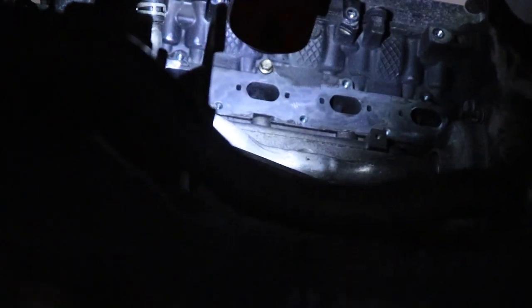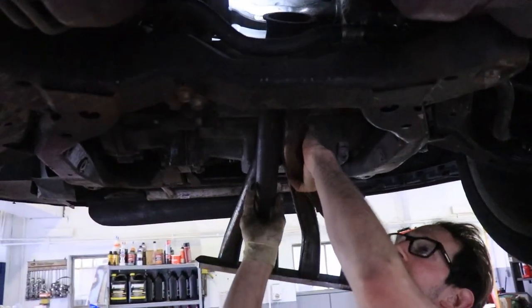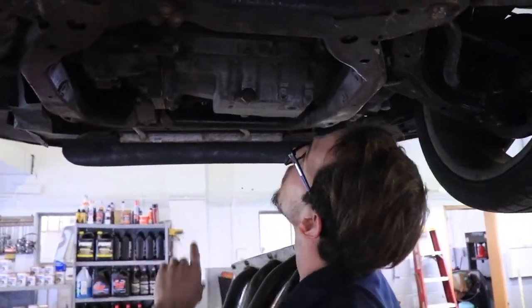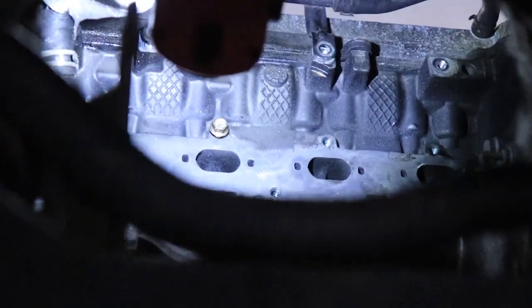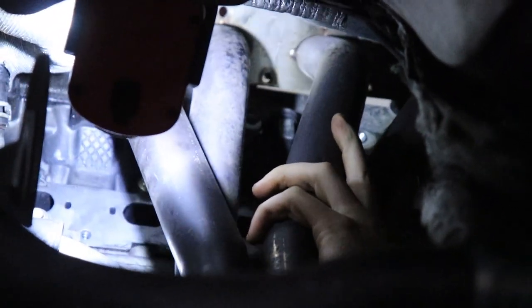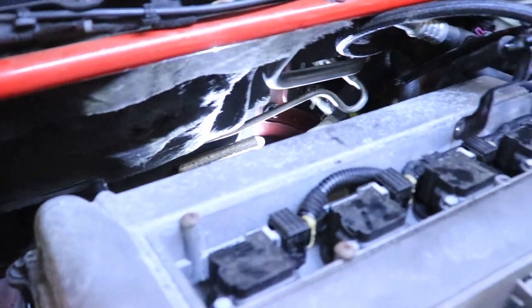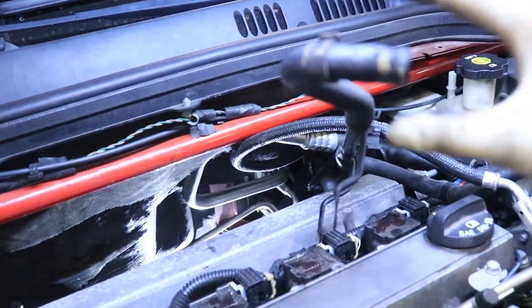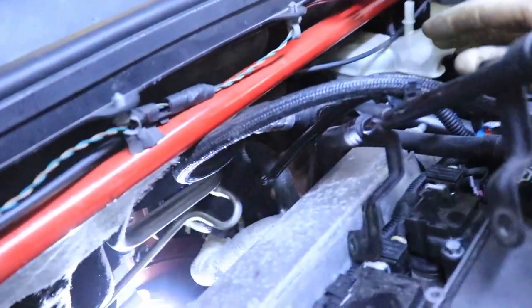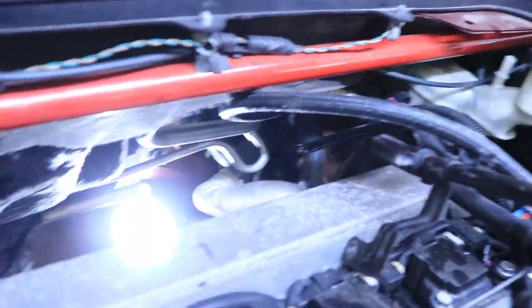You've got to push it up and past and then bring it back down, because you can't go in from the tunnel since it's too wide, and you can't feed back in first and go down because of the pivot. So I'm going to move that PCV line on the top and that'll give me enough room to get the flange portion. It hits that hose up there, stopping me from going any higher and I don't want to hurt or rip anything. So I'm going to bring the car down, just detach it from the valve cover, move it out of the way and then throw this up. All I did was detach this hose from the valve cover — just pinch it with a pair of pliers, slide it back, grab with the pliers, twist it, and push it right off. I also detached the fuel line — it has two clips, one goes up, one goes down to open the mouth, then I just pulled it up and put it to the side.